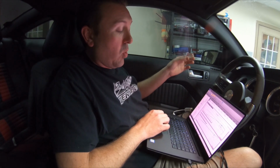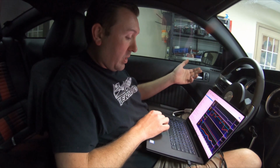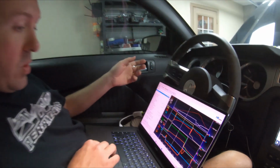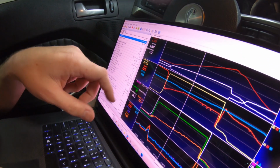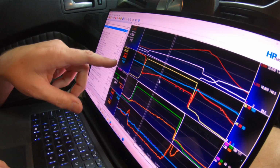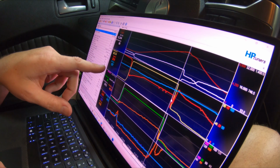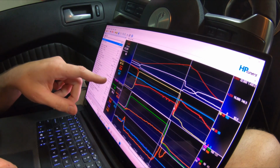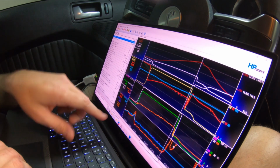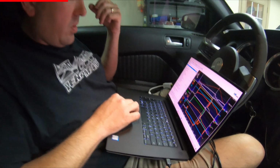And then above 6,000, you see that it takes more boost to make anywhere near the same power and then falls off from the VMP Gen3R. Let's go look at the tuning parameters, make sure all of those are consistent. We're locked in at that 22 degrees of timing. And let's look at our air temp 2. Air temp starts around 113, 22 degrees. We go up here, air temp hits 126, 127 at the rev limiter of 7,000, and we're at 22 degrees. Air fuel's good, 0.82 lambda. Everything here looks good tuning wise.